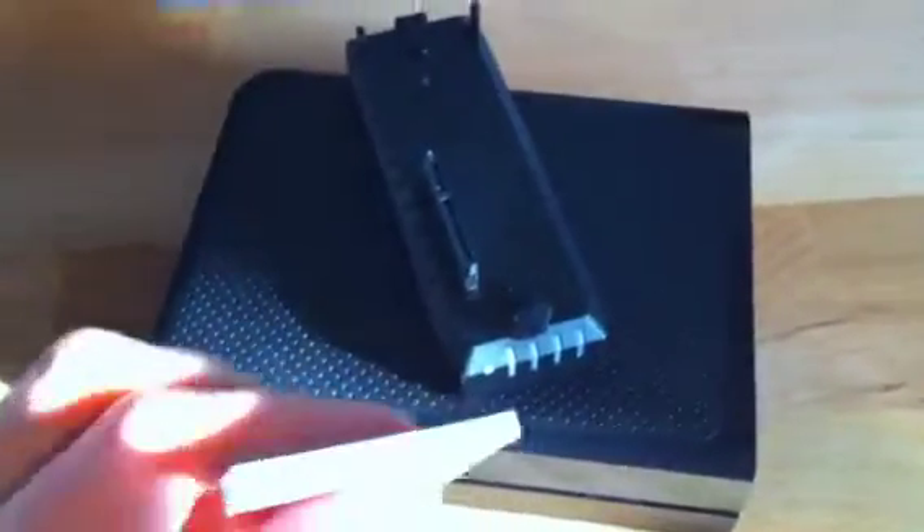But proof of concept, it does connect without any difficulty. I thought, well, I just need some sort of spacer plate here. So I went as simple as possible and just took a stack of business cards, placed them under the side there with the disk until I had the right amount, then taped them together. I marked this so that years later I don't forget what it was and throw it out, then cut a little key into the side here for the one plastic circle, as well as cut out the section for the SATA header, and that just fits into place, keyed over here.